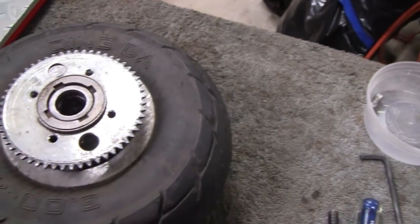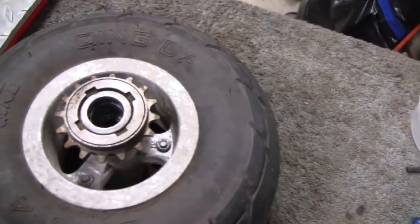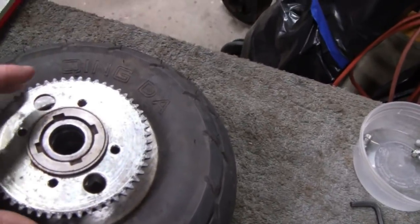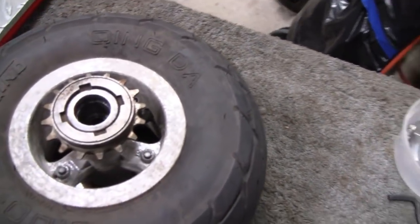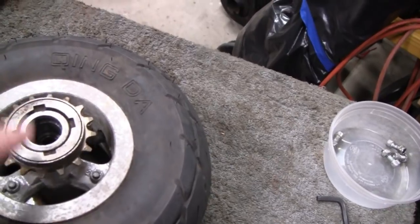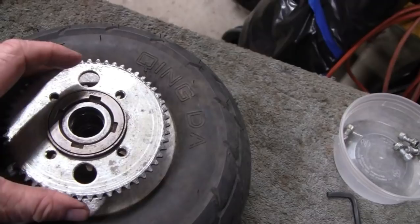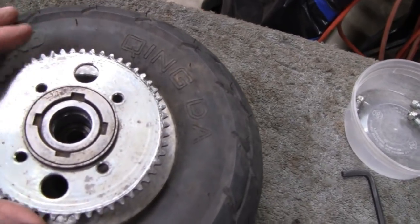I ordered the bearings, and this sprocket — I took this sprocket off and last week Mike noticed it. There's actually another sprocket under it. I wish we had known this earlier because we would've used that chain. That's a 41 chain. So we're going from a 25 chain, which is probably the weakest you can get, to a 41 chain, or a 420, which is a mini bike grade. I think this wheel must have come off of a pocket bike or something — a little baby motorcycle — and somebody just put that sprocket on. It's funny how well that fits on there.